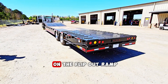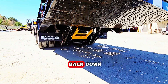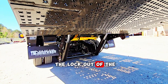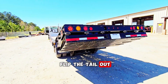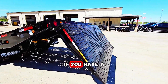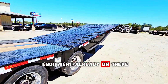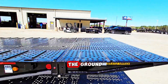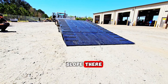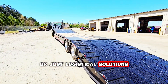Daniel is going to hit the remote control to do the hydraulic flip-out ramp. As he goes up, there's a little yellow bar that catches and gets out of the way when he goes back down. He goes all the way up, then hits that button to get the lock out of the way, and then flips the tail out. This also lets you move the tail to different heights to reach dock height if you have equipment on there already. There's a 10-degree slope so you can load rental equipment, construction equipment, or logistical solutions.